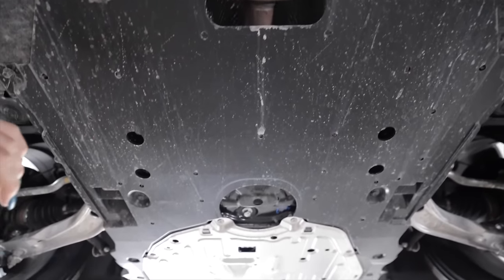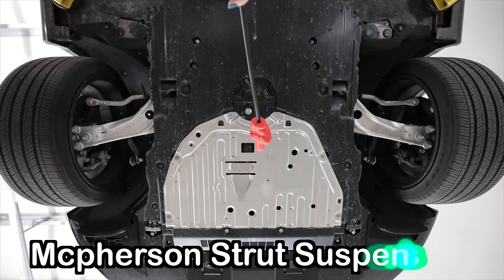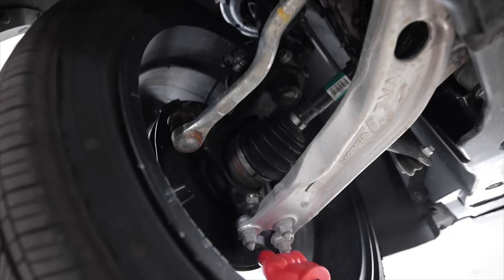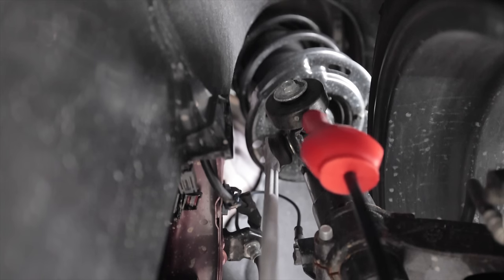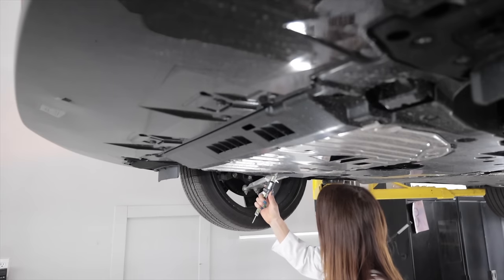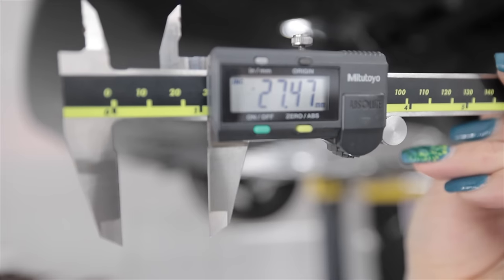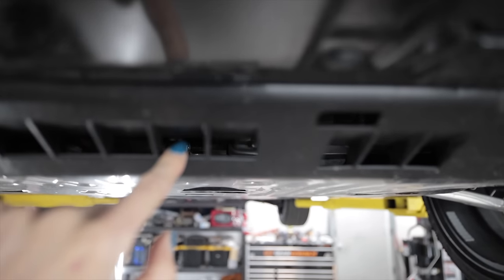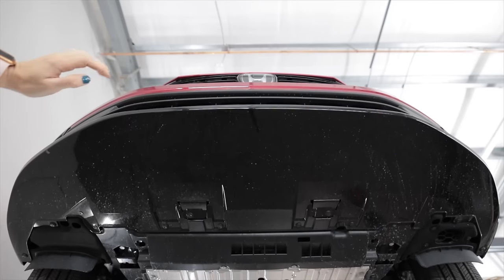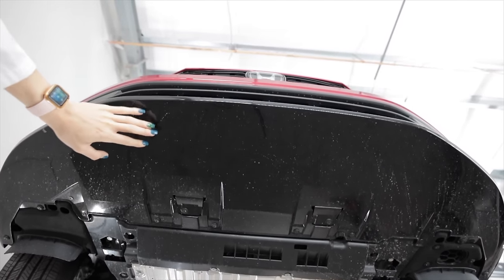You have this massive plastic splash tray, and then underneath the engine, an aluminum one. Front suspension-wise, the Accord utilizes a McPherson strut design with cast aluminum lower control arms and a steel knuckle. There's a little vibration barnacle attached to the strut where the end link bolts up. Miss anti-sway bar up here measures in at just over 27 millimeters — that's also tubular. Those little cooling portals in the underbelly plastic let you see the oil pan on the engine. That's actually an impressive front splitter on the front bumper cover — all bumper cover, all painted gloss black.